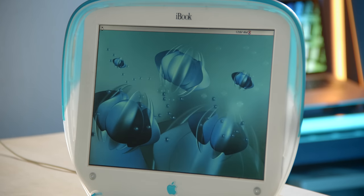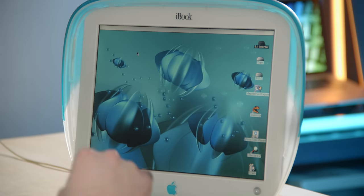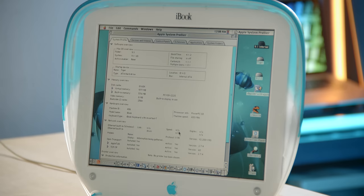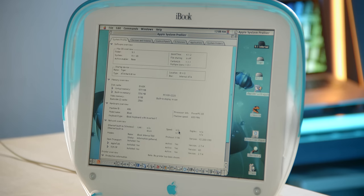Now we wait for it to start up. Let's go to the system profiler. There is a 466 megahertz G3 in here, but with this build of Mac OS 9 it reads as 600 MHz. So right here: processor info, PowerPC G3, machine speed 600 megahertz. It sounds like it's magically faster, but the weird thing is after you boot into the system and it reads the wrong clock speed, every other system you boot into afterward — until you reset the CUDA — operates very slowly. You're about to see how slow.